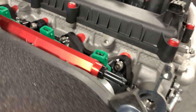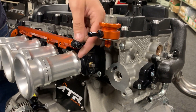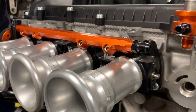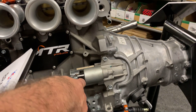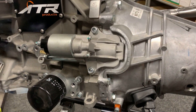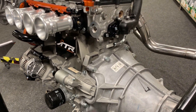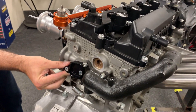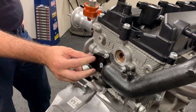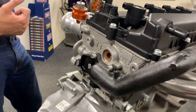Then we have the fuel regulator, which you can see on the other engine — on a bracket at the back, or it can be mounted on the bulkhead depending on your application. This fuel rail has the dash six fittings and we do dash six on the fuel rail to match. Running a standard starter motor — we've got both the Ford and the Mazda variants depending on which flywheel offset you're running, but typically we're running the lightweight Mazda flywheel. On the back of the engine we've got the EGR blanking plate — a nice aluminium billet part that blanks that off and stops exhaust gases coming through.